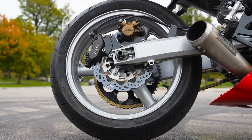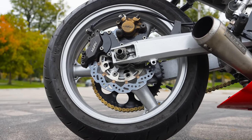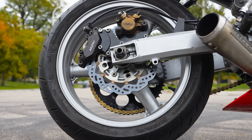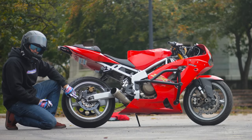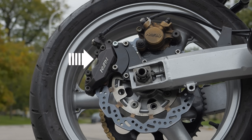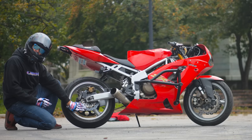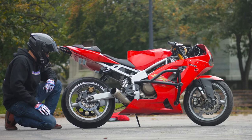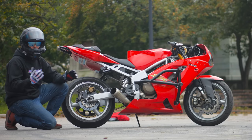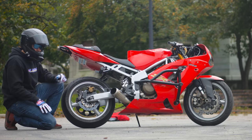Let's talk about another part you're not going to be able to get — the Hohe Bracket. It's just an old piece of technology I bought on this bike, and I'm super glad I still have it on there. I have an F4i four-piston front caliper for my handbrake and an F4i footbrake caliper for my footbrake, all wrapped onto a 250-millimeter rotor — just a little bit bigger than stock. It's enough that it bites down and will lock up the rear tire, but I'm no European guy with ten brakes on this thing.